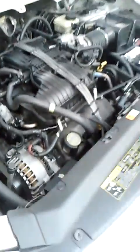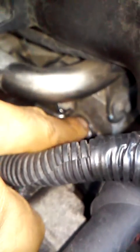However, I decided to put the thing back the way it's supposed to. And like I said, once I put it back, I started getting the noise and I said, what is going on here? So, I decided to remove the little levers, metal sticks that move the butterflies to the intake of the manifold. And I decided to open the butterflies all the way.